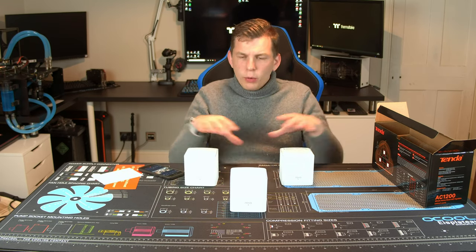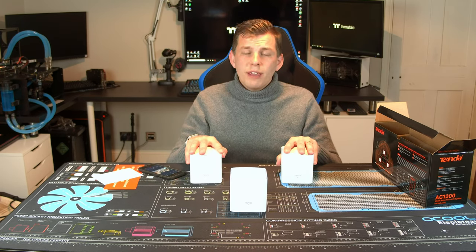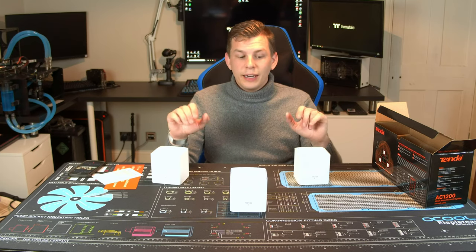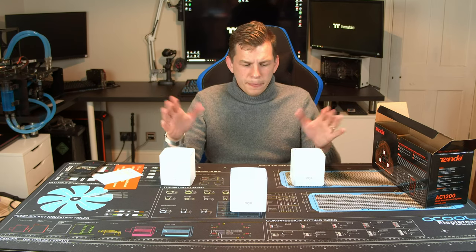The way mesh Wi-Fi works is rather than having separate networks dotted throughout your house — with a traditional system, even if you use the same SSID or name, you would find that until you physically disconnect from one network, you won't connect to the new one. Mesh Wi-Fi works by having all nodes talk to each other, and one will basically say it's giving you better internet and automatically swap you to it completely seamlessly. I tested this while on FaceTime walking through the house — it swapped me through the networks completely seamlessly, not a glitch in the conversation. If you're playing a game you may notice something, but for things like FaceTime, no issues at all.